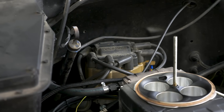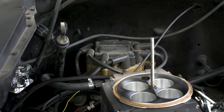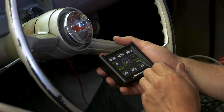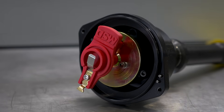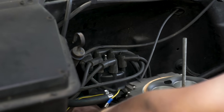So far we've only talked about fueling, and of course there's spark — more specifically ignition timing — to consider. At its simplest you can just leave the existing distributor to take care of spark, just like it did with the carb. This means that short of swinging the distributor to advance or retard the entire ignition curve, you don't get any timing control. If you do want complete control of the ignition timing, you can add the optional HyperSpark electronic distributor, which allows timing to be optimized at each RPM and load point, potentially producing more power than the ignition curve offered by a mechanical distributor. Not to mention, the original distributor on some of these engines is probably well past its use-by date and not offering optimal spark energy anyway.